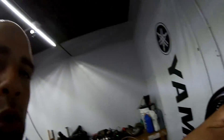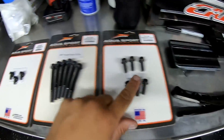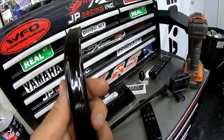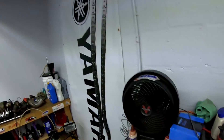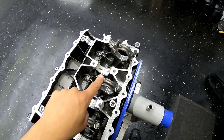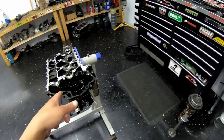Here's Rick's bottom end stuff. These are the new rod bearings — I use only Sea-Doo OEM parts for this. We got the rocker arm ARP bolts, cam gear bolts, flywheel bolts, and some new timing chain guides because his old guides got all chewed up from the previous timing chain. The big one is the new timing chain, and the ARP rod bolts. We're gonna be switching the bearings in each rod, putting the ARP rod bolts in, then get the crank and balance shaft in there.